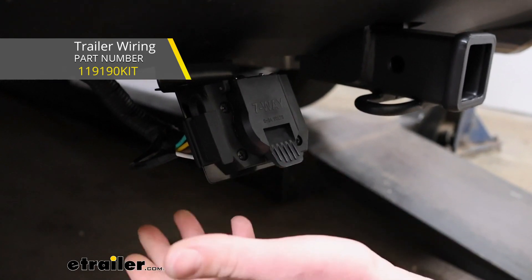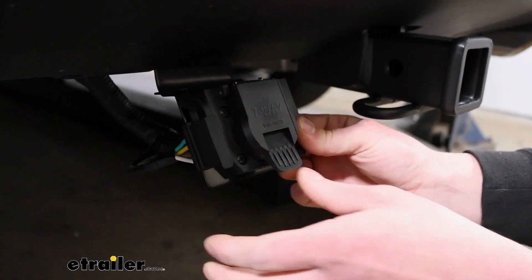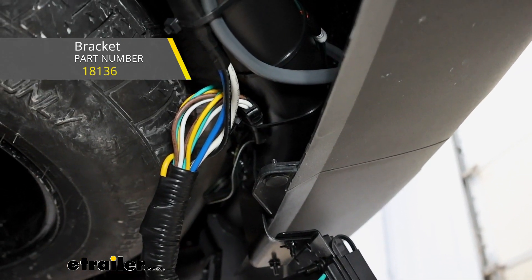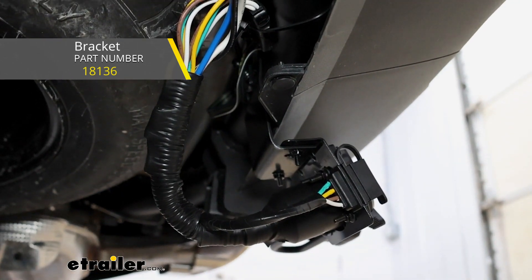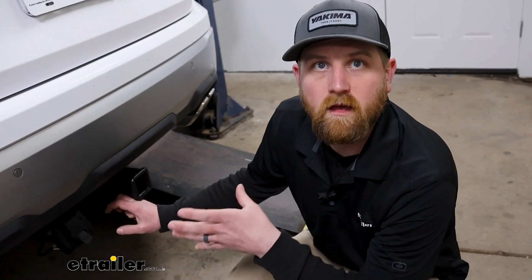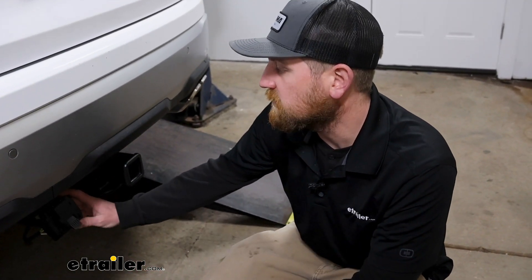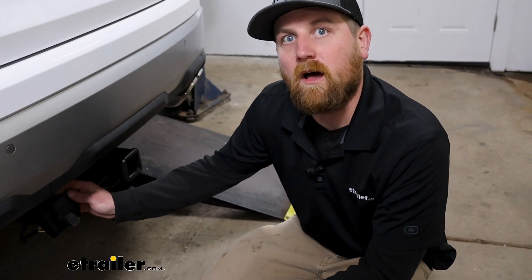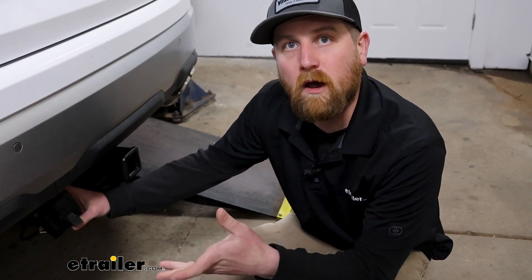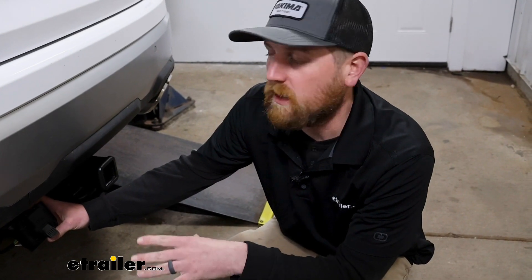On ours, we used the Tekonsha universal kit and it worked out really well. This kit will give you a bracket to mount up your seven-way, but if you want it sorted like ours, I used a no-drill long bracket, clamped it to the hitch and put a bend in it so it kind of pushed it out and looked decent and was easily accessible. If you're trying to hook up a brake controller to your Telluride or just want a fully functional seven-way back here, this is definitely the way to go. As far as the installation is concerned, it's quite a bit of work — there's a lot of wiring to route — but hopefully we can help you get going in the right direction. As long as you stay focused, you shouldn't run into too many issues.